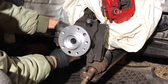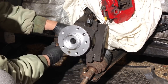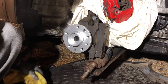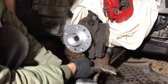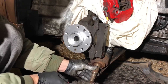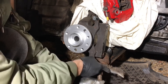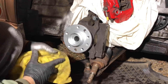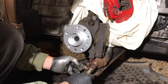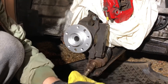Make sure you've got everything you need. The hub is now bolted back on nice and tight. Before you put the drive shaft back in, clean it up — there's a lot of surface rust on it, so go over it with a wire brush, make sure the threads are clean, then apply copper grease over the splines. That way it won't seize when you need to remove it in the future, and it allows much smoother fitment and removal.